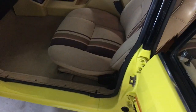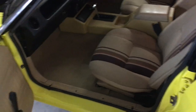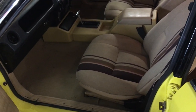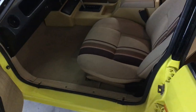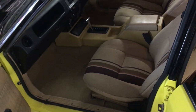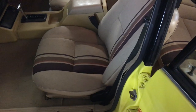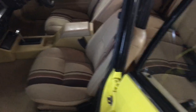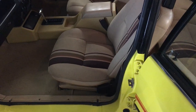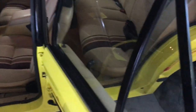You've got to disconnect the battery - mine's in the boot so I've got a different setup up the front. Then you've got to pull the seats out. First thing, pull the front seats out - you've got to go from underneath the car, jack it up, get under there and undo the four bolts. The challenge is they are old bolts so they probably won't come out easily. Give them a hit with a wire brush, a bit of WD-40, and they should come out. Use a rattle gun once you've got them moving because the threads are long.